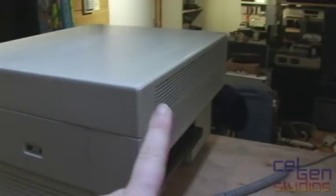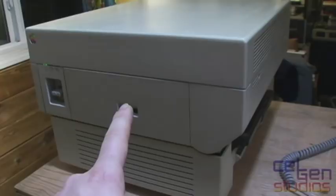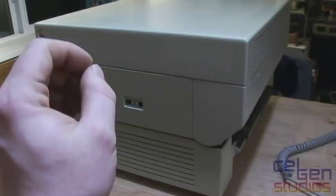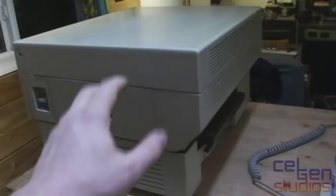So I can verify, I can send data from a Mac through AppleTalk to the printer. The printer, which contains the PostScript language, a meg of RAM, and a Motorola 68000 CPU, and cost $6,000 when new, American, roughly, is taking that data, processing it, making the image data. It's got good rollers because it's pulling the paper in, it's got a good Corona wire on it, it has a good laser assembly, it has obviously a bad drum, but it also has a good fuser. So everything about the printer that's the hard stuff to service and replace works. It's just a toner cartridge.